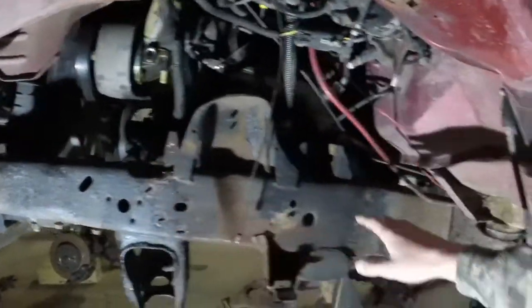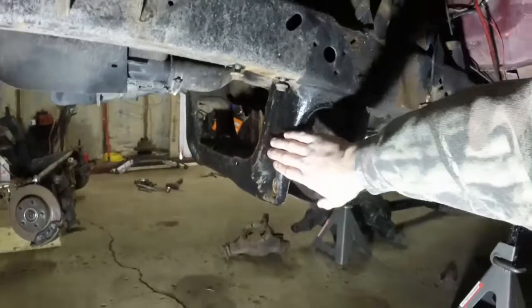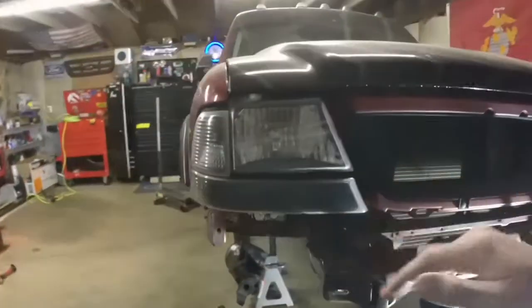On this side I cut one bracket off, this one and this one — but I'm leaving this main one in here. I already ordered a leaf spring hanger that's going to go up front. It's going to be welded in between my frame rails and have the shackle mounts on either end for the leaf springs. That'll help support the frame, so I don't want to cut that out and risk the frame moving out of whack.